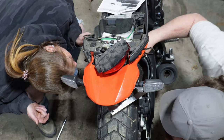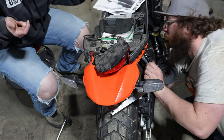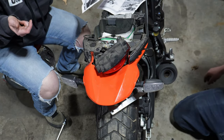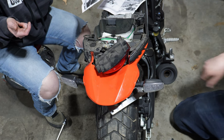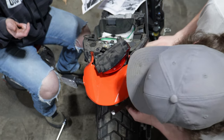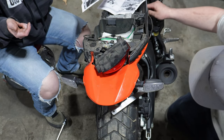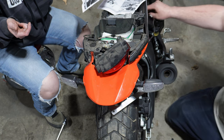The plug is all the way down here on the swing arm so we're going to have to peel this plug back a little bit. According to instructions: route license plate light wire through opening between rubber tail light mount and down right side of sub-frame. Plug in near swing arm pivot. Zip tie as desired for exhaust clearance.